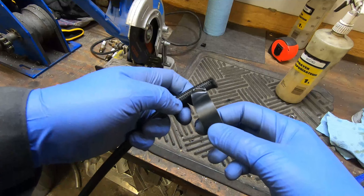That was pretty painful - the weld. I knew it was going to be a bit nasty because it's cast aluminum and it's soaked in oil on the other side. I tried to get it clean. Anyway, I got it - I have the 90-degree on there right now just to mock it up. I'm probably going to put a 45-degree fitting on there. I'll clean up that weld a little bit. I think it's going to be strong and watertight. But that was way more hassle than it was worth.